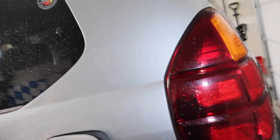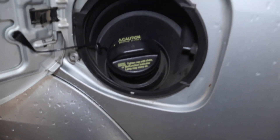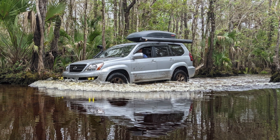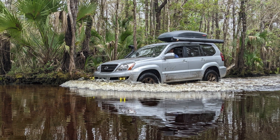What this will do is extend the normal breather valve that is on the rear differential, and I will route it up through the gas cap. I'm installing this diff breather because if you go through any water that gets above your rear axle, it can get inside and completely ruin your rear diff — better safe than sorry for $20.